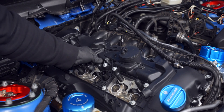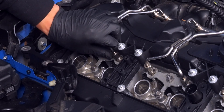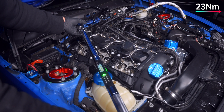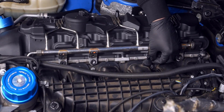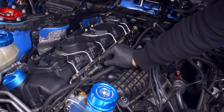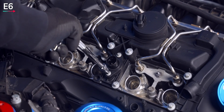Remove the rubber cap and bring back in the fuel rail. Connect the lines in reverse order from how they were loosened. If threads don't line up or have excessive resistance, apply some downward pressure on the lines as you thread on the nut. Tighten the six small lines with a crowfoot wrench to 23Nm, while the 17mm gets 30Nm. Try to have the crowfoot at a 90-degree angle relative to the torque wrench head for proper torque application. On the mounting side, place back the metal sleeve in the rubber fitting, then torque the 11mm bolts to 13Nm before plugging in the fuel rail. Don't forget the guides and wires along this side. Install the new Valvetronic actuator seal and screws — make sure the gasket faces down, and tighten in an alternating pattern to seat the gasket evenly.